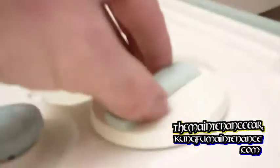See, now it latches and I can't just push it open. On the other side we're going to rotate the dial until the soap dish would open, while holding both halves together since it's not screwed together. If you tried to reset it in this position, obviously it's going to just pop back open. So we have to rotate it back to about the beginning section — that should reset where the spring is. We can retest it: there we go, it locks in good. Now we're ready to put our screws back in and put the door back together.